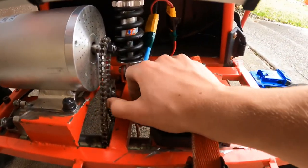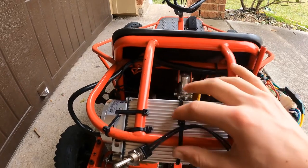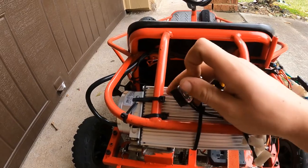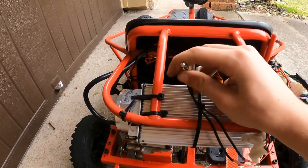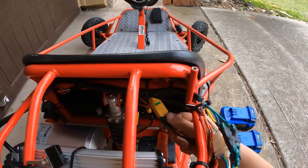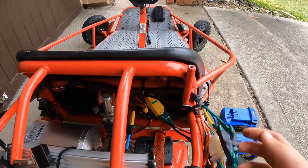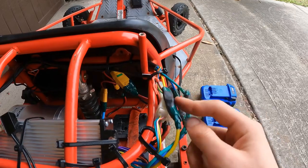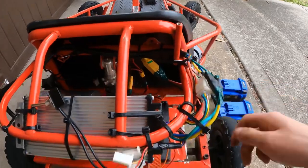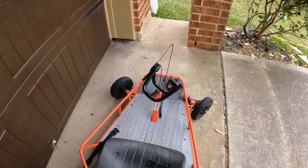We just used the stock chain tensioner and it works fine. We have the controller which came in the kit with the motor — I'll link all that in the description of this video. We have a toggle switch here which you use to just turn it on and off. We have XT90 connectors which I ran this time because they're a little bit better than the XT60 connectors — they have built-in spark arrestors. I use a lot of shrink wrap because it's a lot better than electrical tape and it seals around your solder a lot better. And I used a lot of zip ties because they're the best — so thank you, zip ties.